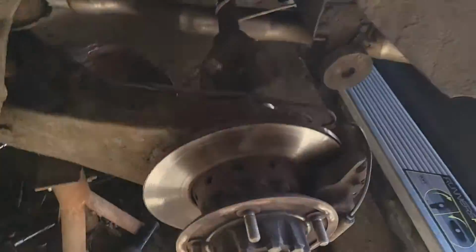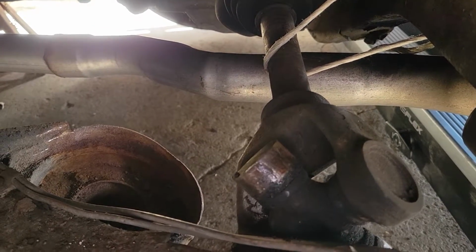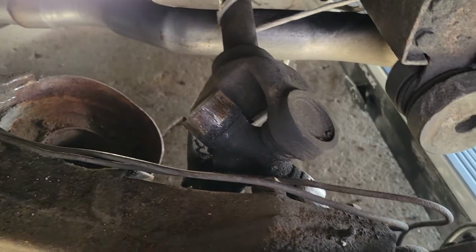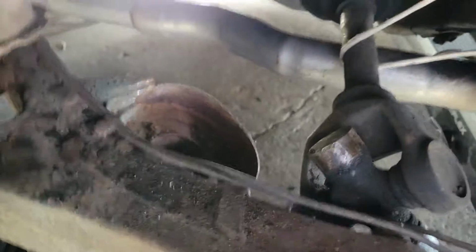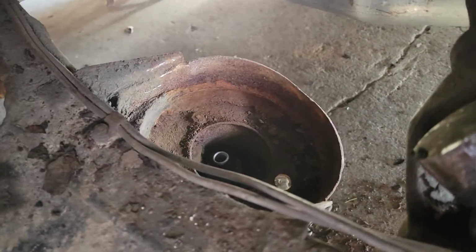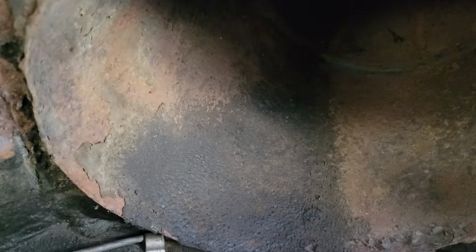I'll show you what I'm talking about. It's kind of tight in here. Of course, that half shaft is unbolted from the hub right now, just to give me the ability to move the suspension all the way through its articulation without putting a bind on that exhaust pipe. But that exhaust pipe is kind of tight in here. So if I put the air spring down here in the bottom of the cup, it's going to be awfully close to that exhaust. And I don't think I want to put that much heat into that airbag. So instead, we'll put a lower cup in there, make up part of the difference, and then the air spring can live up inside the spring pocket. It'll go up inside there and be up out of the way. Things will be a little bit more protected.